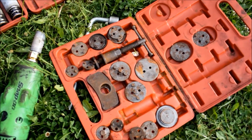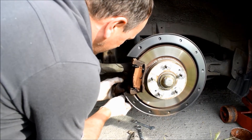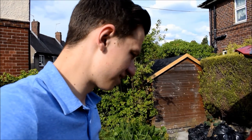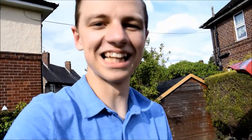My new tool versus my dad's rusty tool that's been out in every weather - but sometimes older and more simple tends to be better. The handbrake cable is still attached to the actual caliper. Where the cable comes through it has a circle that holds it, but it's a bit rusty so we don't want to mess with it. We don't want to risk taking it off, snapping it, and never being able to connect the cable back to its position again. So we're having to wind back the caliper whilst it's still attached to the brake line.